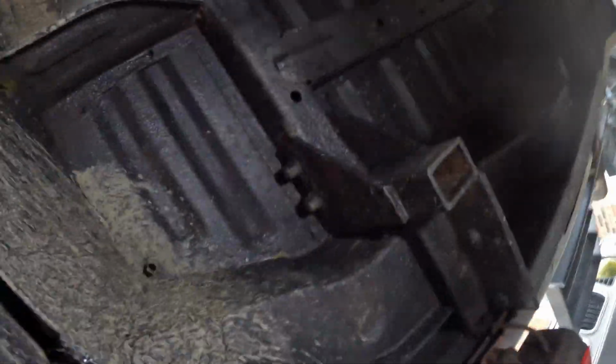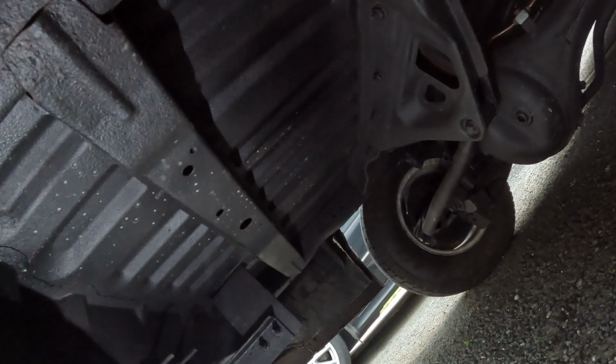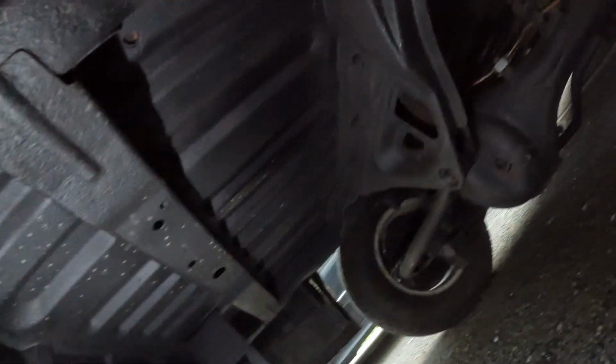See this one? And there's a few extra ones that didn't record. So there's one up there. There was one somewhere else, I can't remember. So I went over the undercarriage of it with a needle gun, a wire wheel, then hit it with some red oxide primer, some stone chip, some new brake lines there too.